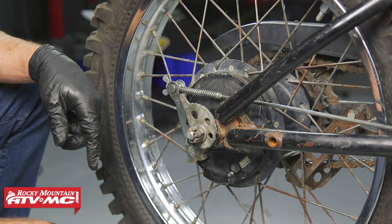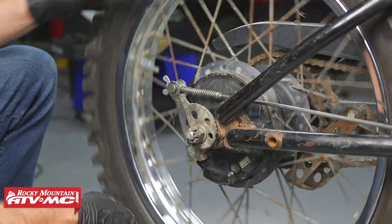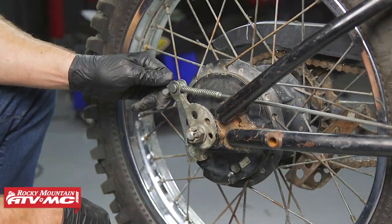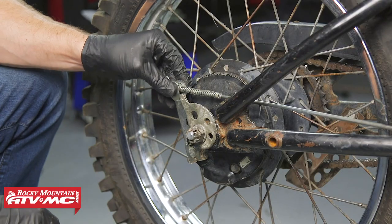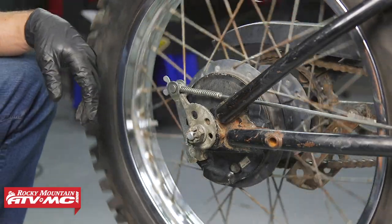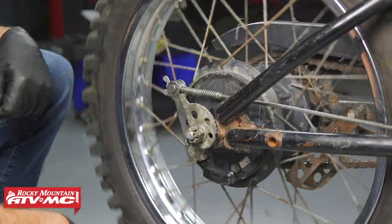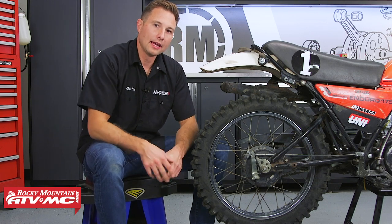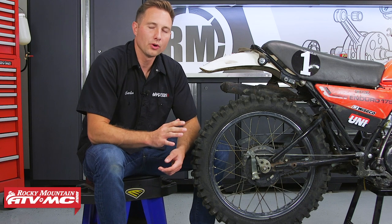When you hook the brake rod back up, you're going to need to adjust it. Refer to your model-specific service manual for the correct adjustment. But something quick and easy: adjust it until you have some slight drag on that wheel — you can hear it too — and then back it off three, maybe even four clicks from there. Usually three does the trick. From there you can adjust it to control when the brake pedal engages. And no matter what, when you spin the wheel after you have it adjusted, make sure there's no drag at all on those brakes. Those are my tips and tricks to get the best performance out of your drum brakes. If you have any tips and tricks, leave them in the comments below. If you need any parts for your bike, check out our website for both OEM and aftermarket parts, and subscribe to the channel for more helpful content. Thanks for watching.